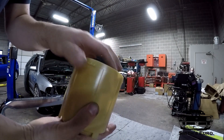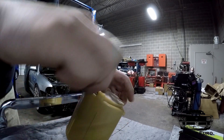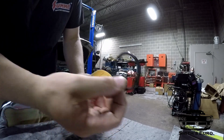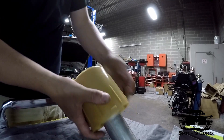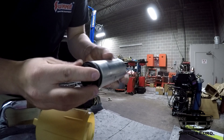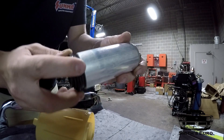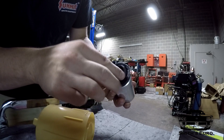To get the fuel pump out you have to come down here and take this basket off — just work it around. The fuel pump is usually stuck in there because it has three O-rings: one on top, one on the bottom that goes right here — never cover that up if you're putting in one of these or a DW pump — and then one O-ring down at the bottom.